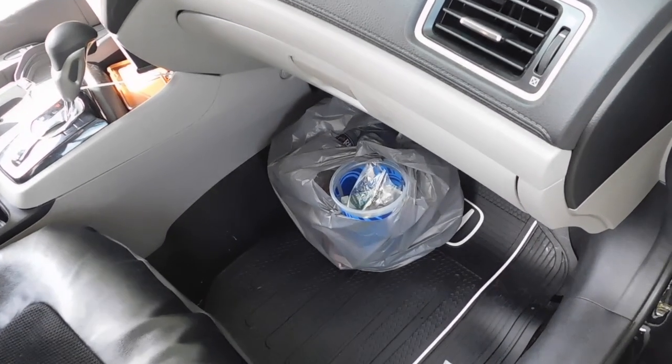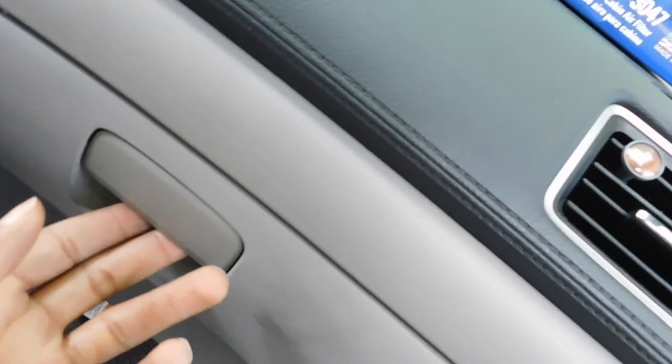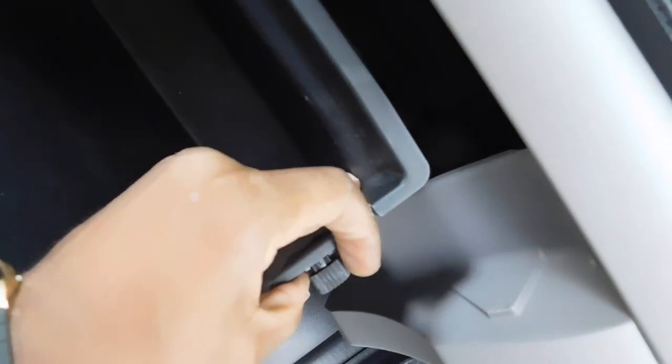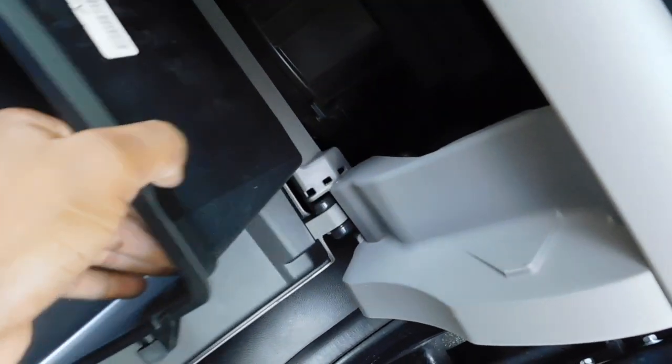What's going on? We're looking at changing the cabin air filter for a 2014 Honda Civic LX. To access this you'll need to get to your glove compartment on the passenger side and push those two sides inwards until both knobs are revealed on either side. Be mindful that anything in your glove box will fall out if you do this, so you might want to empty that out first.